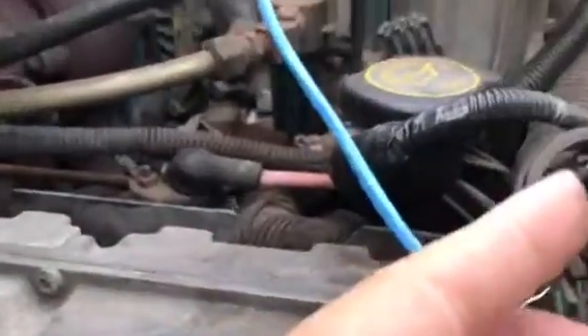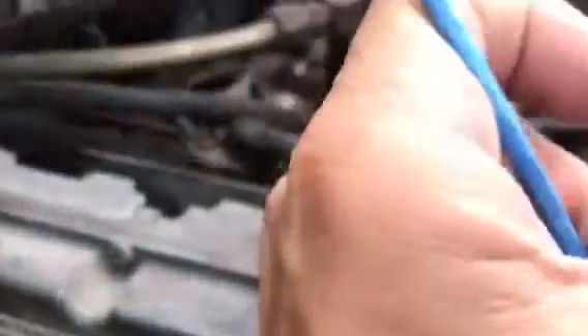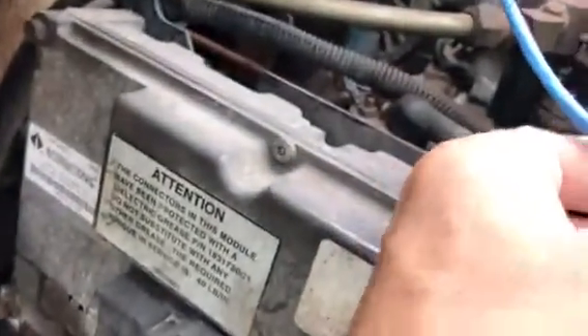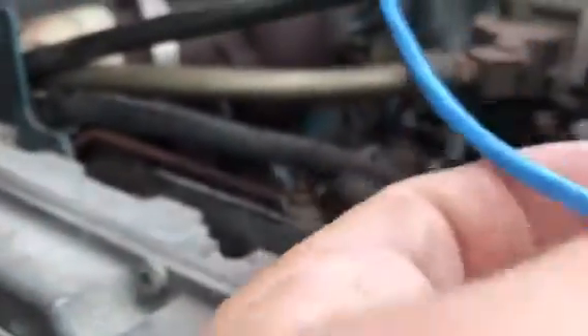The right polarity should be that the green wire goes to the white one. I stripped these wires and I'm just going to shove them into the connector here — really quick, just shove them in and see if this works. This is all totally hacked; we're not going to drive it this way. However, we should be able to see throttle on our TCM monitor. The yellow wire is the other one; the black one is a ground — a reference ground — which we'll have to hook up if we want to make this permanent.